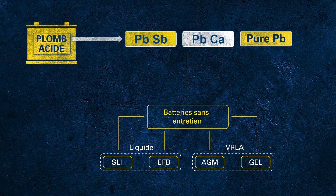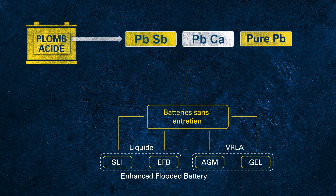Let's shed some light on the abbreviations used here. SLI stands for Starting, Lights, and Ignition, which describes the main duties of a conventional starter battery in a conventional vehicle. EFB stands for Enhanced Flooded Battery. This is not a protected term, so every change one applies to an SLI might then be called an EFB. Usually, EFB indicates a flooded battery with improved cycling capabilities. However, as this is still a flooded battery, it is not as robust as VRLA technology.